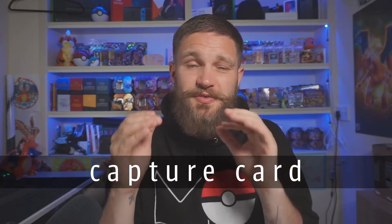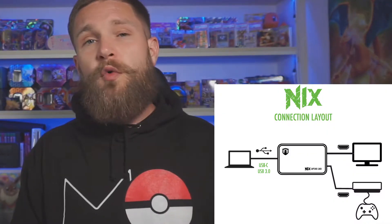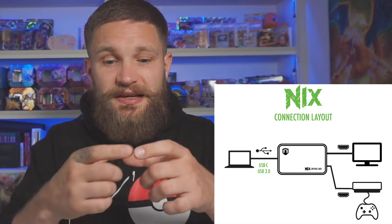This is a pretty important one: if you're planning on streaming your games console — Xbox, PlayStation, Switch — you need a capture card. I recommend the HD60S. It's still over 100 pounds so it's not cheap, but it's good value for money and it's what so many streamers use. What it does is take the HDMI from your console, pass it through to your monitor via HDMI, and then a USB cable goes into your PC so your PC can see the image and relay it to your streaming software. You can't just plug your console straight into your PC.